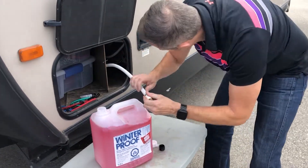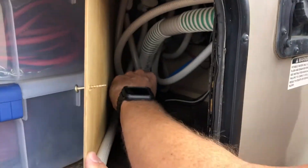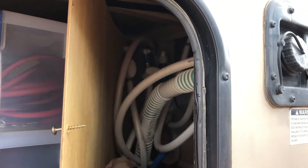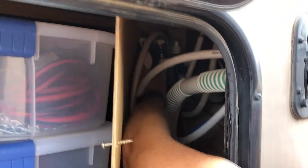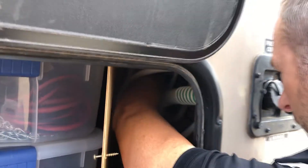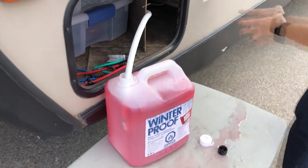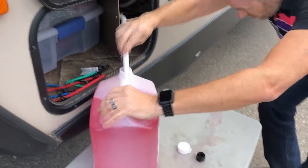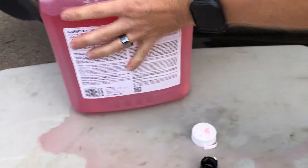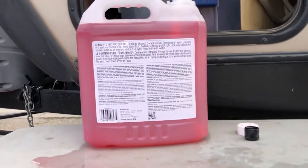You can see it still had the pink in it from before, but there is a valve — I don't know if you can see in here — there is a valve at the top of the feed line up here. You need to turn that valve. There it is. Open it. That will make sure that the water you would normally hook up to here is bypassed. I want to make sure the line is in the bottom of the container. Okay. Now we go turn on the pump and start running water through every tap.